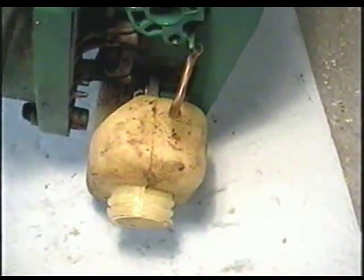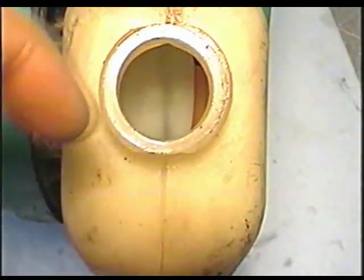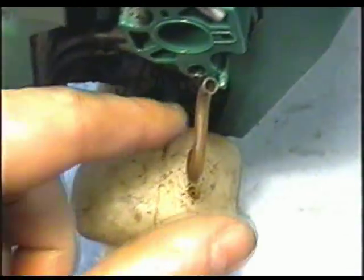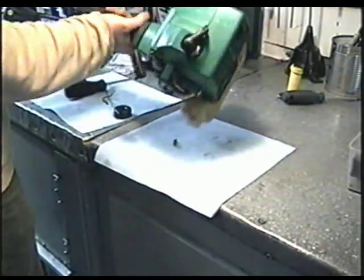I'm going to check inside to see the fuel filter and retrieve the fuel line out of there. The fuel line is broken right in there, so I'm just going to pull it from the top. Remember which fuel lines you're taking out. This is the small line, so just remember that. Now on this side here for the primer fuel line, I'm just going to push it in and empty out the tank.